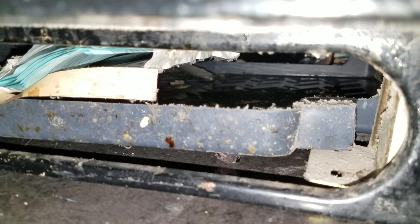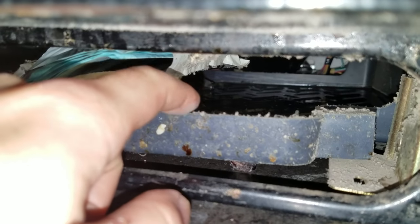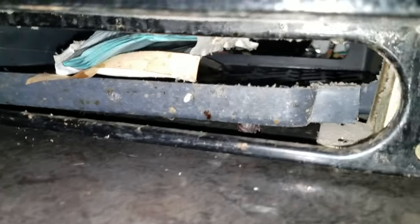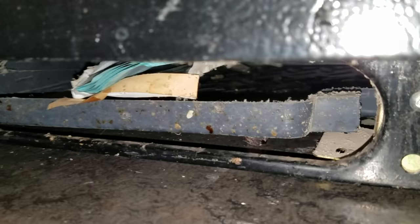See that black hose back there — that's the drain. You can see the water moving, which shows that the drain is now emptying out into the drain pan. You can see a bunch of water in there, so it all went down and everything is okay. Just an ordinary clog. That black drain hose is sometimes easy and sometimes hard to get out from the back. Simple tip to unclog your defrost drain! If you enjoyed this, subscribe, hit that like button, and we'll see you next time on Lex's Lounge.